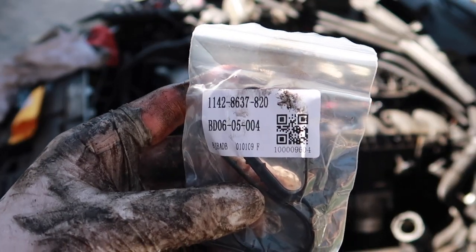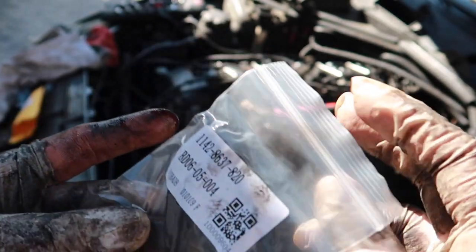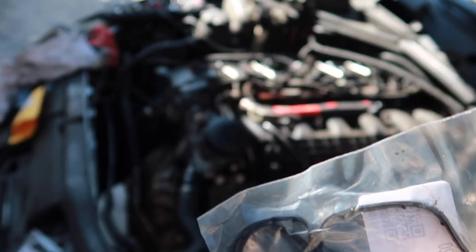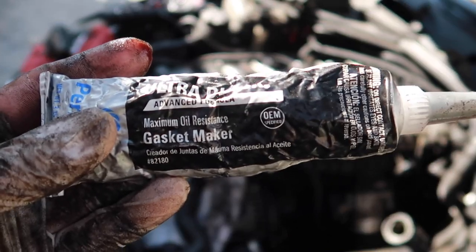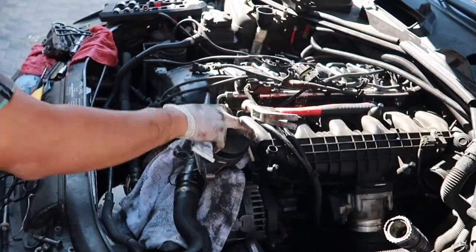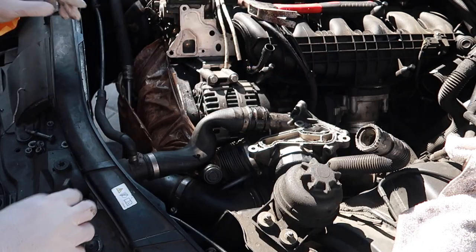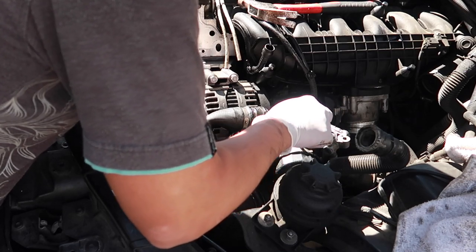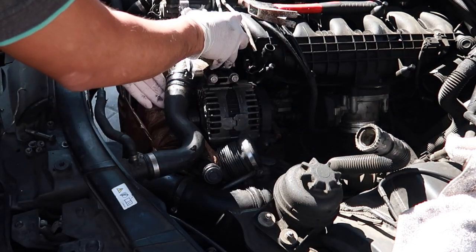These are my gaskets - I got these on Amazon for no more than 10 bucks. They had a whole bunch of good reviews. Here's the part number if you guys are looking for it - I'll put the link in the description. It does come with the one for the block and the one for the transmission line. I'm going to put gasket maker on first - don't ever put this on by itself, it doesn't really work. I'll put this under and then throw the gasket over it for a little extra protection. Now applying the gasket itself - it fits pretty good, not too loose, not too tight, which is what you want. Both gaskets are in, going to start bolting everything back on.